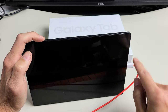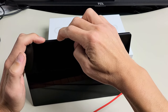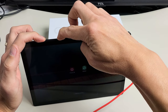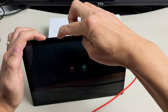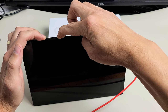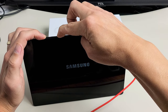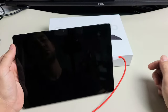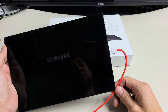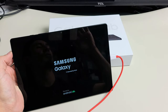Power button, volume down. While it's plugged in, press and hold both buttons. Pretend my screen is black — I have no idea what's going on. I'm just holding on to both of these buttons, forcing it to restart. Continue to hold until you see the Samsung logo. It just turned off. Samsung logo is there — let go of both buttons. Now just wait, and hopefully you are now out of the black screen. If you're still in the black screen, we're going to go to the next possible fix.